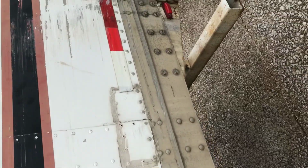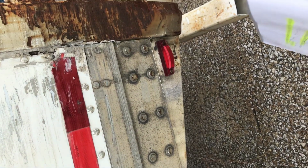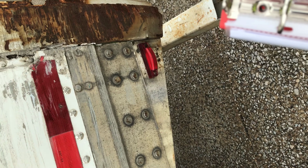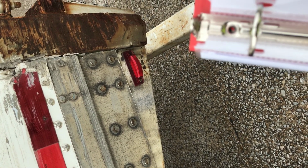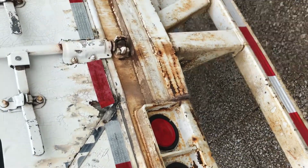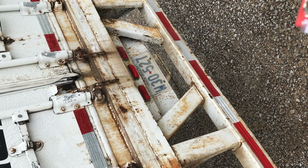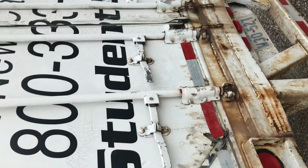Rear trailer now. You want to start right here on the very corner. Tail lights, identification lights, all marker lights, including the one on the side of the rear, are clean, functional, red in color. Left and right, red turn signals, clean and functional. Four-way flashers, brake lights are functioning. Reflector tape and red reflectors in good condition. Also one up here.